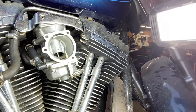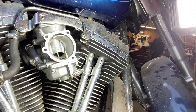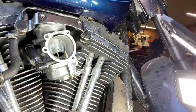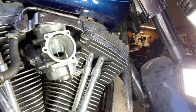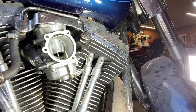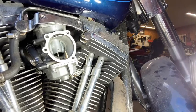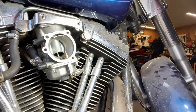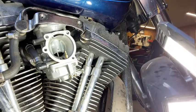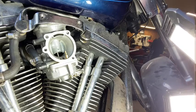Let's start it up to see if she starts. Everything should be clear. I want you to notice right here the accelerator pump - you're gonna see how it shoots fuel into the throat of that carb. Let's give her a whirl and see if we hear a little Harley rumble. Mission on! Let's see if she starts. Oh boy, that sounds good - nothing like it! And son, that sounds pretty dang good. Going to strap the rest of this up and do a few tests on this old girl.